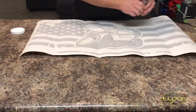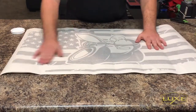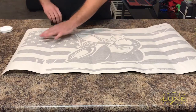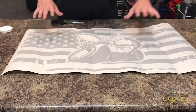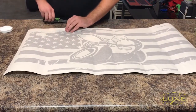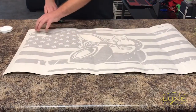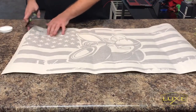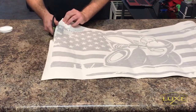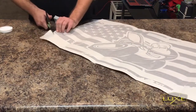The only other thing I'm going to do before putting it on the vehicle is trim it. This is actually easier to do with scissors than with a knife. I'm just going to trim around the edges — this lets me place it right on the sunroof and really line things up. We don't do this beforehand because we have all this extra transfer paper in case any fuzz gets underneath it. I'm getting pretty close, like a sixteenth of an inch to the edges. And hey, it's a distressed flag — if you accidentally chop into it, it doesn't really matter too much.